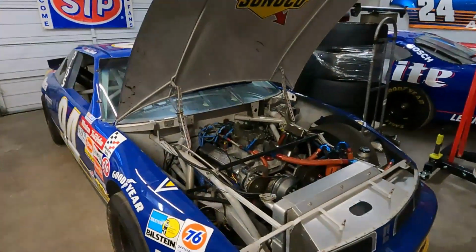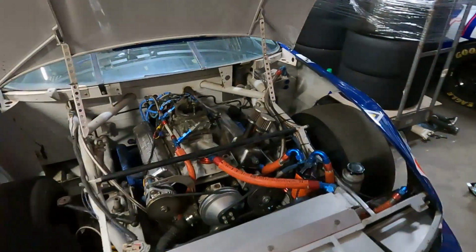So that was bad. One of these plugs, the gap was almost non-existent. There was maybe like a 0.5 millimeter. You can see just a little bit of light through there. So hopefully this thing is going to run a whole lot better. Some of the wires were bad, some of the plugs were bad. I mean, what a mess. But let's try and fire it up, see what it does.